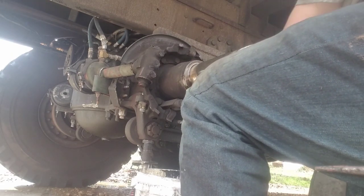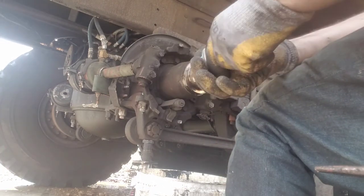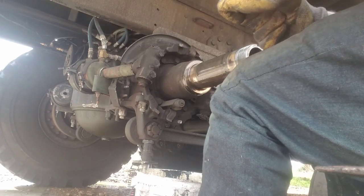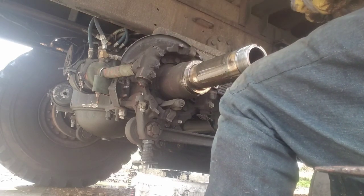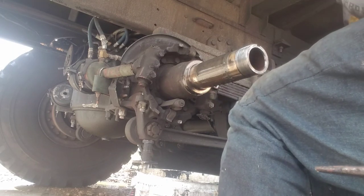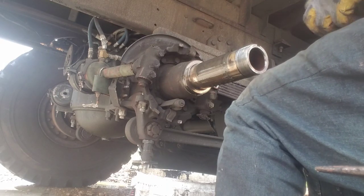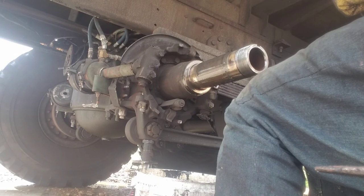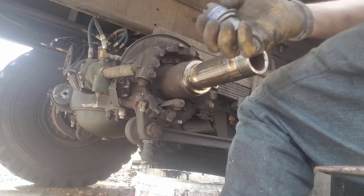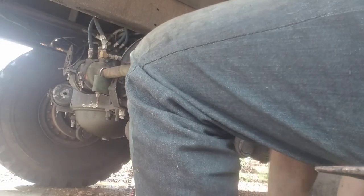With the new ones force it over the head. These ones from Memphis Equipment — they made these little gaskets and grommets. They're not real friendly but they should sit in there just right. Of course you're gonna want to adjust up the lower one — screw the lower one in clockwise.